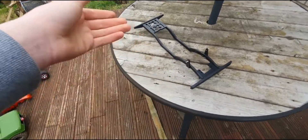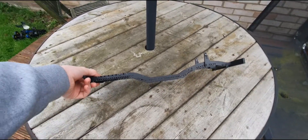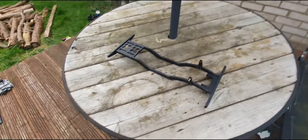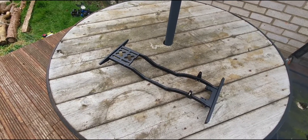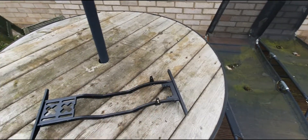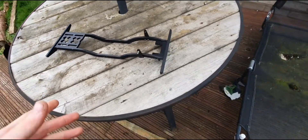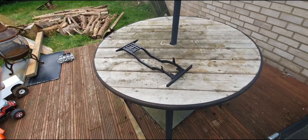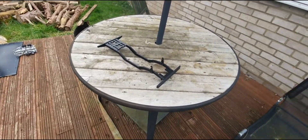Next chassis - I bought this off Matthew as well. I buy so many things off Matthew. It is a cheap eBay leaf spring Land Rover chassis. This is going to get a Series 3 body made out of a Defender 90, chopped up in the front, to make it look like a Series 3. It will be leaf sprung, motor in the front, full depth bed, because it will be a pickup. It's going to be pretty much a Trail Finder 2 on a Land Rover chassis - Trail Finder 2 suspension and axles, just not gearbox. It'll be getting an eBay gearbox.